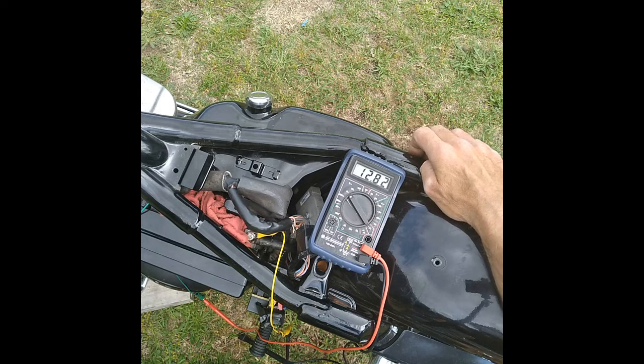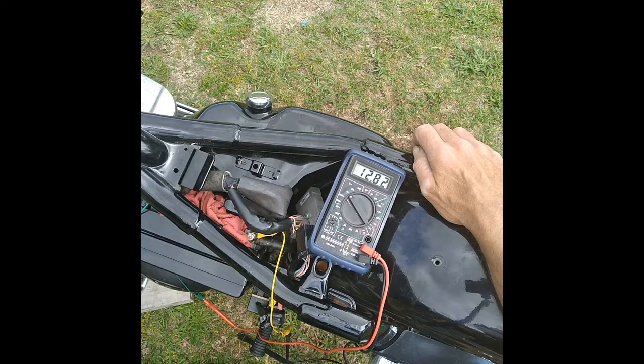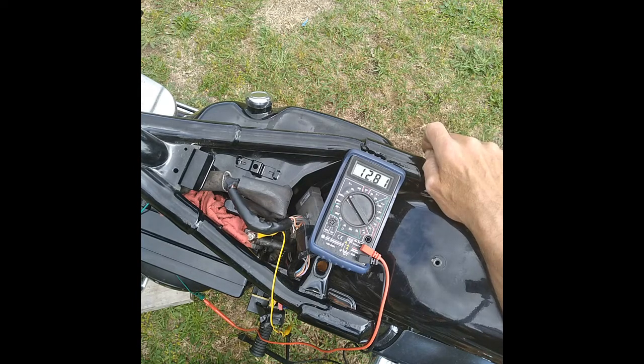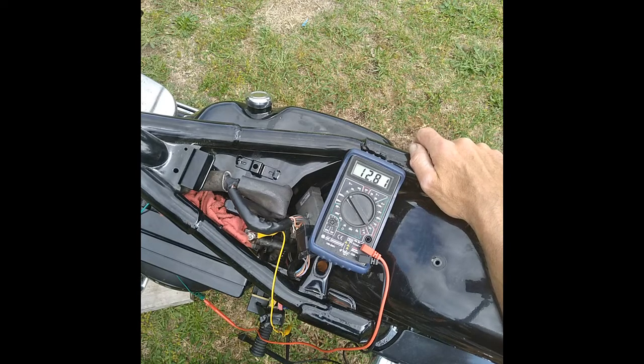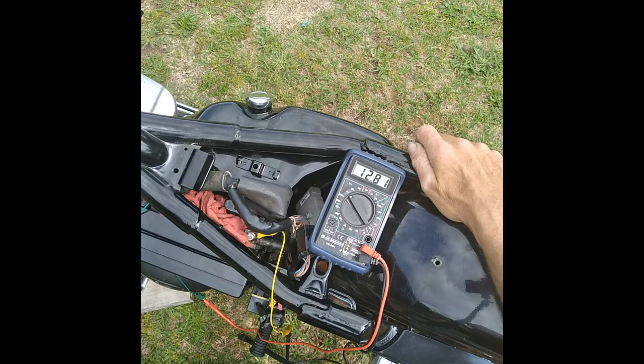If you're checking your grounds on that stuff, just because your meter says that it has a ground doesn't mean it has really good ground. It could have one little contact point in the ground, which isn't really enough, and your meter is saying that's good enough. You want to use a pretty heavy wire — really good contact where the regulator ground is mounted to the body. Just like an old car, old truck, old tractor, you need a pretty substantial ground cable. Bigger cable passes more current through it; smaller cable doesn't. Fairly simple concept.